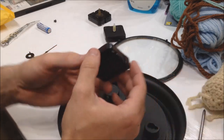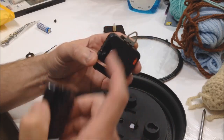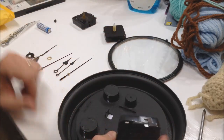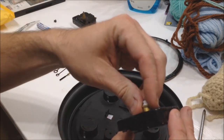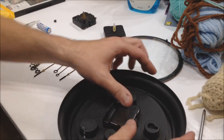A few things to note when buying these: here's an older one with a hook on the back — if your clock hooks off the mechanism, you'll need to get one with a hook. Most of my clocks don't, so these are just plain units. The other thing to note is they do come with washers and a little nut that screws on. Some clocks use that nut to secure the mechanism to the face.